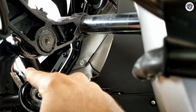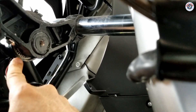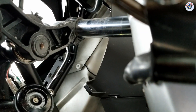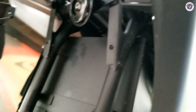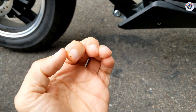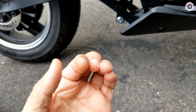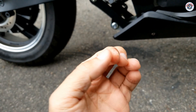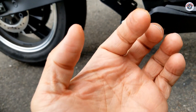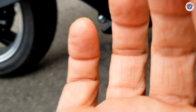The steering is open on the bottom — this is the bottom of the steering — and you can almost see the bottom of the bearing. Right now it has a little bit of WD-40 on it. On the other one which is still having the issue, I may be able to show the problem better. Here it is — this is the grease they used and it is really sticky. It's not nicely lubricating; it's almost starting to polymerize and getting plasticky. I think this was the issue — it was not well greased.